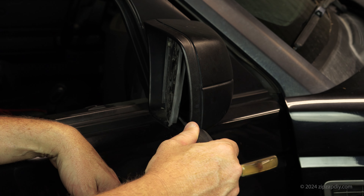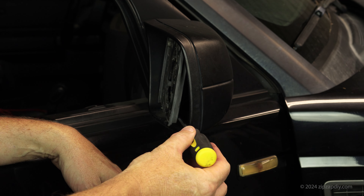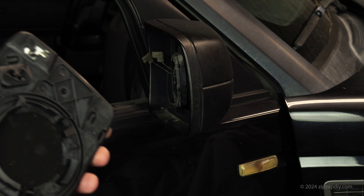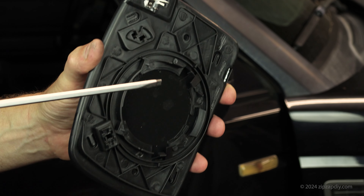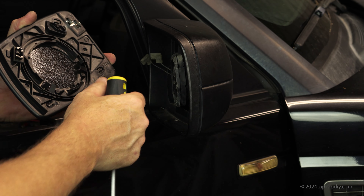You can see that the trim on this deteriorated and fell apart. I was able to pull mine out, which is fortunate because now we can see what's going on in here. You're going to need a thin flat blade screwdriver. There are three clips — one, two, and then a fat one down here — three. Then there are some alignment points that aren't really pins, but little guys that stick out. Here's the new one and these slide on top of that. They don't clip, they just slide down on it. To get this apart we just squish it over — it's not going to hurt anything.